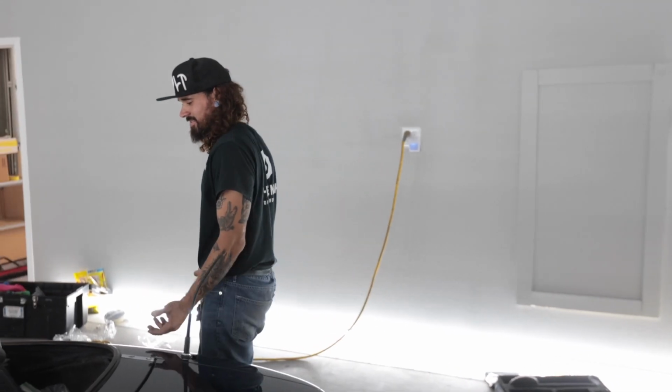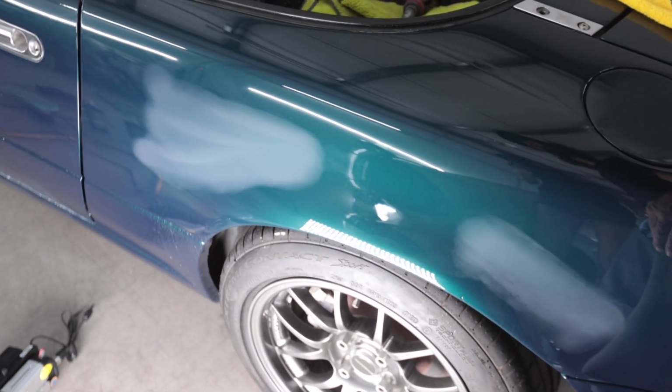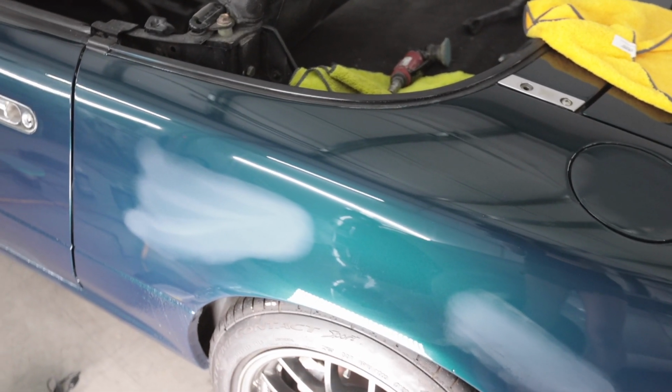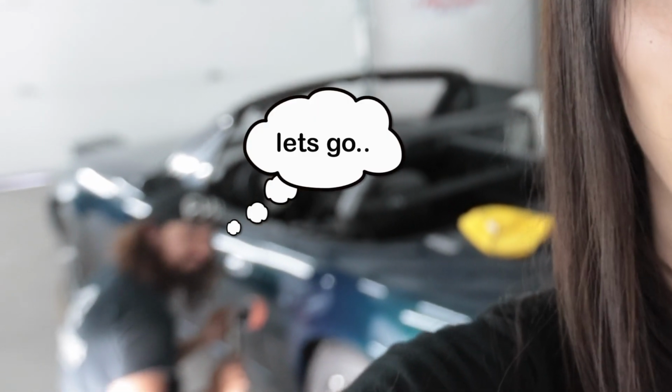Here we are. What was I even getting up for? Why did I move? There were some minute little hairline scratches in the 2000 grit that the average human being wouldn't see even if you gave them a magnifying glass and a flashlight. But we decided that they were bothering us and we had to fix them. Literally no one would have noticed that spot that we just fixed. And we've done that everywhere on the car as we're going around on the stage 2 polish. Everything is going back to 5,000 grit and then polishing again with stage 1 and now stage 2.